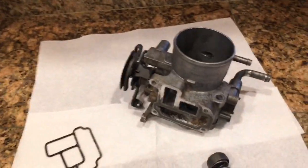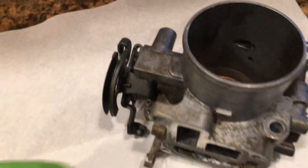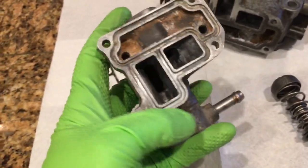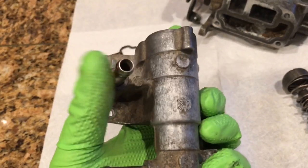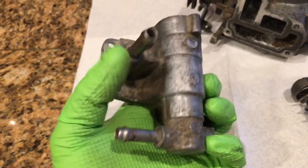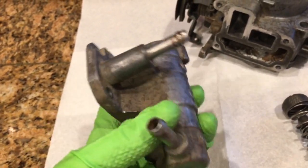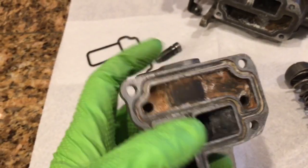If you're having problems with the car idling correctly and you've already adjusted the idle adjustment screw all the way in with no impact whatsoever, and your O-ring is okay, then it's got to be this guy right here. It's got to be that pin is not lifting up and properly sealing off that air channel. Generally speaking, the reason is that you have no hot coolant flowing around here, meaning you've got a blockage somewhere in these little holes or in the hoses that run to this — not letting hot coolant circulate and shut off this area when the car warms up.